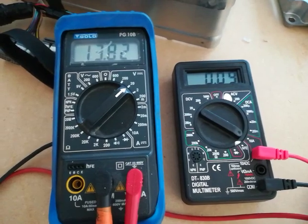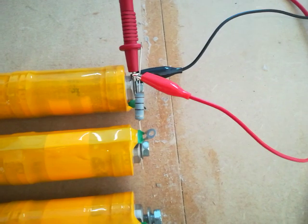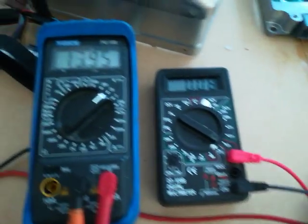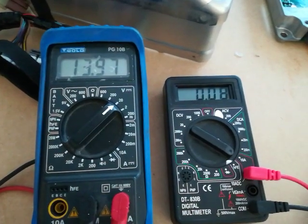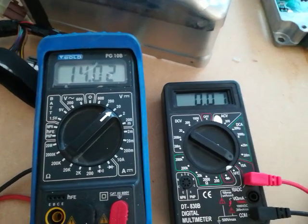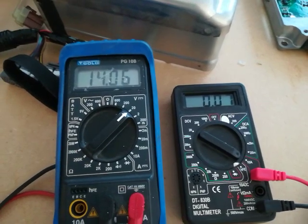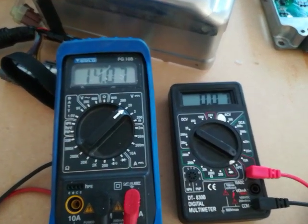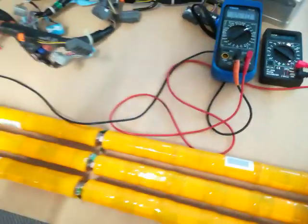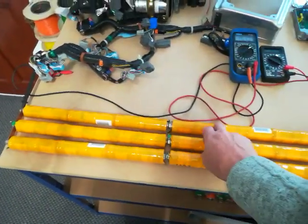...the resistor is still intact. It's a 10 ohm resistor — it's probably pretty warm — but the current's dropped now to 80 milliamps, and that'll be within the capabilities of the resistor. I think it's a two watt part. It got pretty hot for the first few seconds, but the voltage has come up very quickly. Now the balancing current between the two stick pairs — this is the full pair and this is the empty pair.